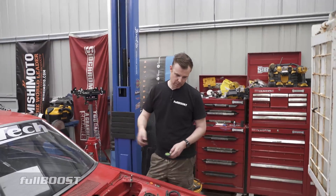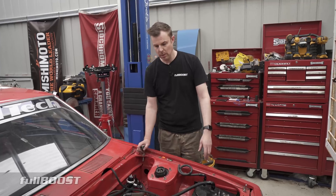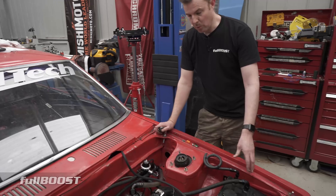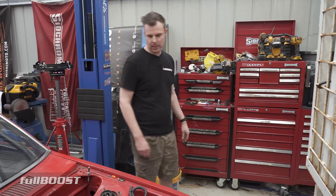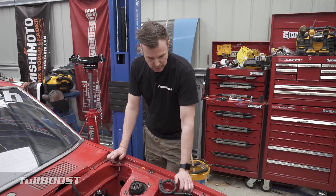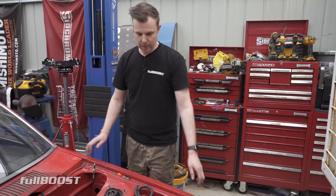There might be some of that residual left in there. And the initial startup - I've got even more premix in here. So normally for racing I'll run 300 mil per 20 litres, or even a bit more, maybe 325 mil per 20 litres. Street guys will run significantly less than that. If I was running methanol I might run 350 plus. But I think I've got about 350 or so in here at the moment just for extra lubrication while it's all bedding in.